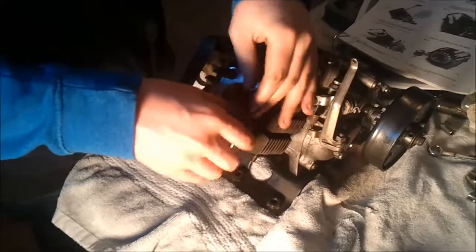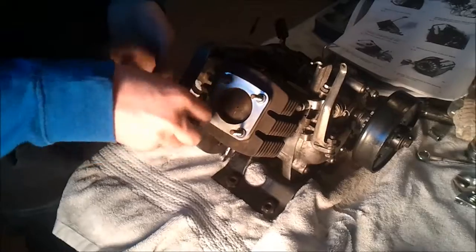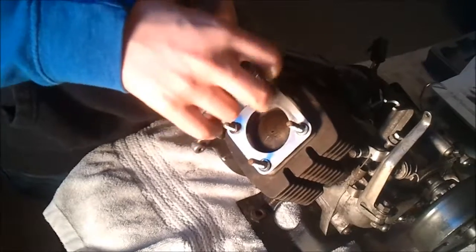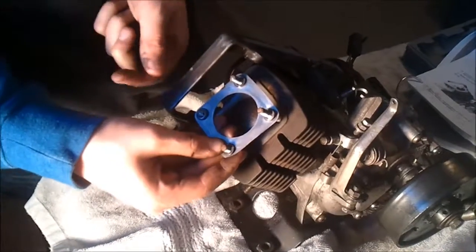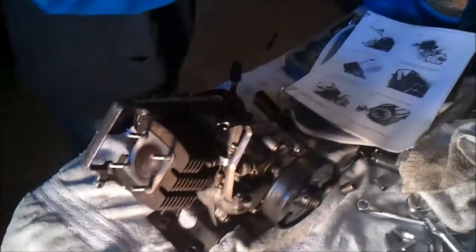That is one small piston — that's what 60 cc's look like. Arrow down goes to the exhaust — arrow is always exhaust, or mag side. So that actually is a metal gasket. Take those off and throw that gasket in the box. It does have a gasket, we'll get a new one of those too with our kit — that doesn't mean you can destroy it though.